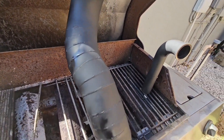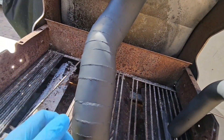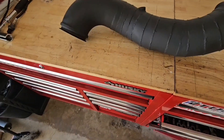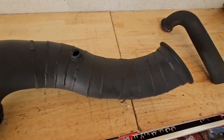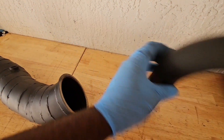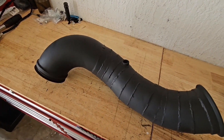I have it pretty much hit. I'm going to let it dry and then start to wrap it. This is a silicone, so it's also going to help the wrap stick to the pipe a little bit better and make it easier to wrap. Let this dry for a bit and then start the wrapping process. They're dry now — as you can see it's like a satin flat black, and they do dry pretty fast. I'm going to wrap it and the wrap will cover any spots I missed, plus I'll spray it again after. Let's go ahead and start the wrapping process.